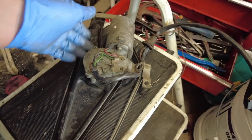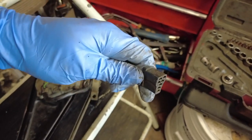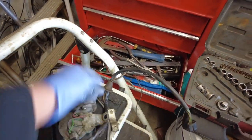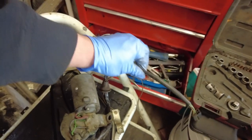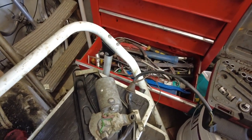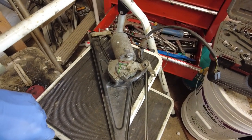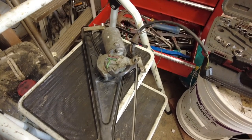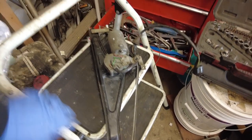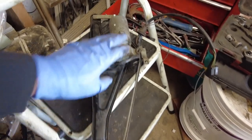The reason I'm taking the motor is because the wiring is all intact as far as the connector that goes onto the wiper motor. I will be cutting that and just putting some connectors on, because I find it incredibly annoying the way Volkswagen didn't include a multi-plug connector for the wiper motor in the wiper box and you have to go fishing for the wires. I just don't have the inclination to do that. Plus I have an intermittent wiper circuit in my car which doesn't exist in most other cars.